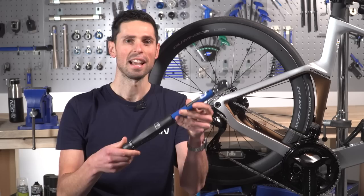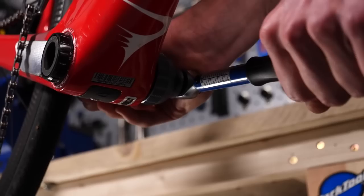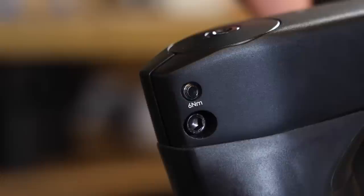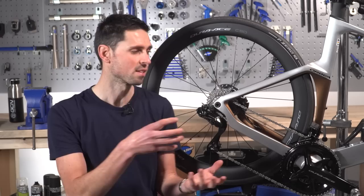As you adjust and set the torque wrench to the amount of torque that you need to measure, as you apply the force and the tool moves, once it reaches that specified torque setting, it will then click so that you know that you don't have to make it any tighter. The torque measurements relevant to our bikes could vary from as low as one newton meter all the way up to around 35 to 40 newton meters. The higher the newton meter rating, simply the tighter that fixing or bolt will be, and it will clamp on even tighter to the component that it is joining together.